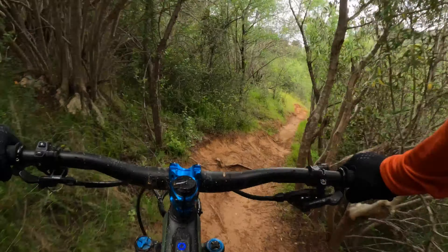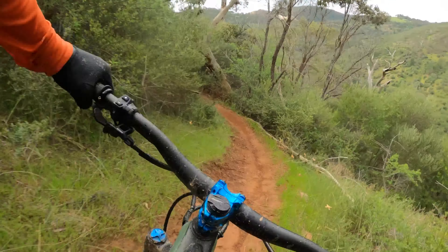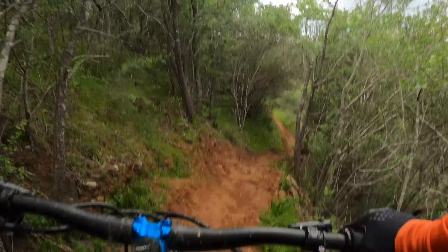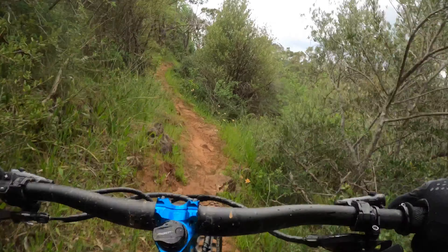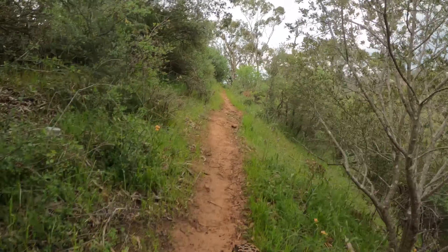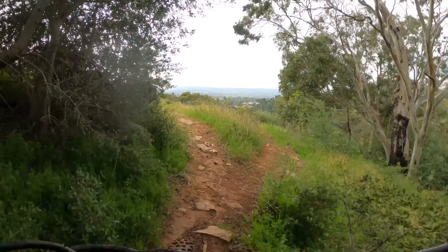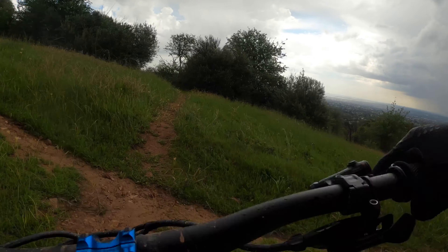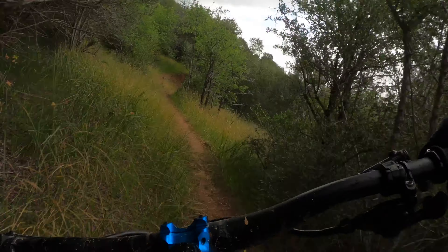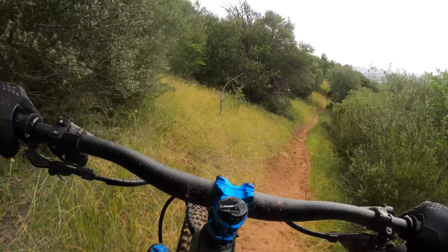Oh, a little roo — sorry buddy, I hope he didn't hurt himself. Certainly choppy — rock on the left so still low pedals. Certainly more feedback on the legs. So maybe down to a 0.4 spacer, or ditch the spacer — you'd need a heap more pressure to have this ride height without the chop, because she is a bit choppy in 29er bird mode.